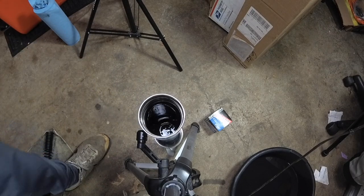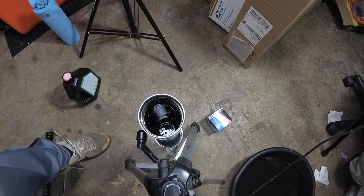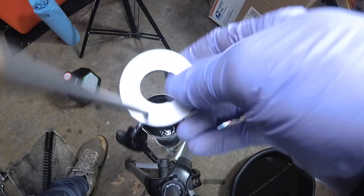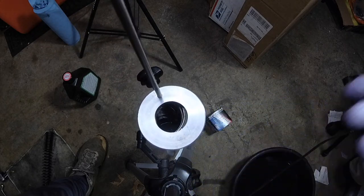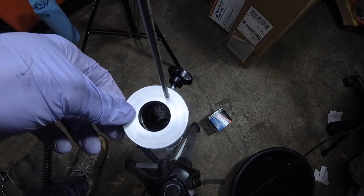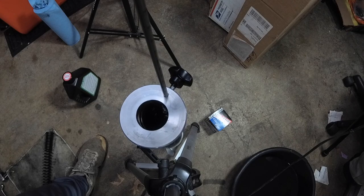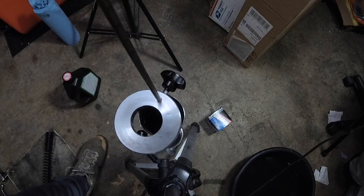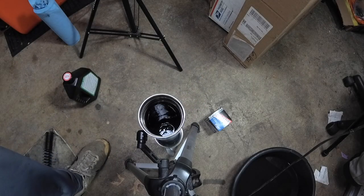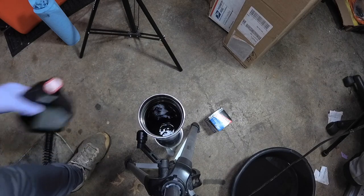Now I'm doing the 5.5 minimum, and I'm running 15 weight. Usually I'd run 10. The manual recommends 10, but I'm doing a 15 weight. They're saying if you're a little bit of a heavier guy, you can run a heavier oil. Not the manual, but just information from online. And if you're a lighter guy, you could run the 10. Still could take a little bit more.